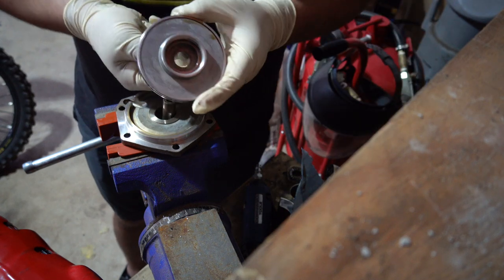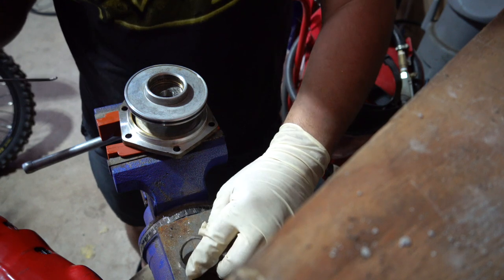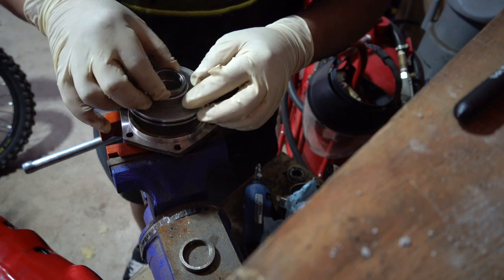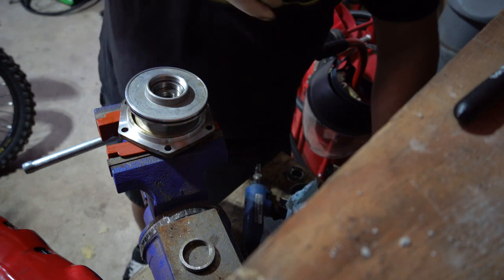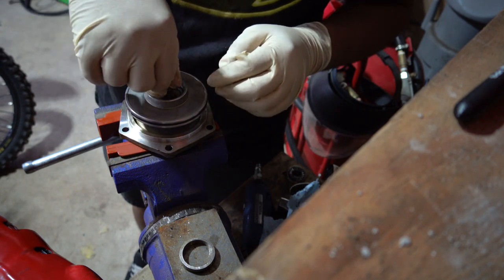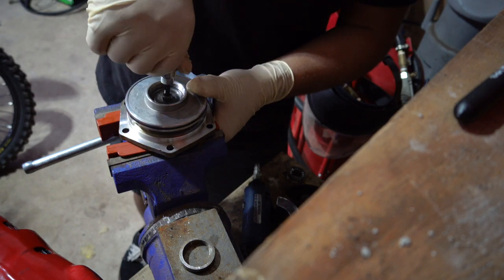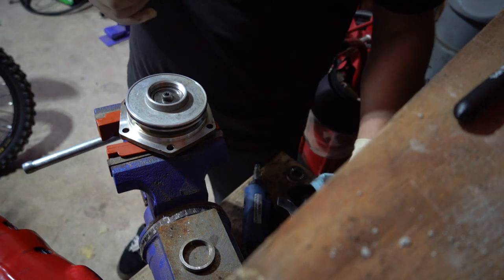We got this other bearing out and now we can take the sleeve off — I'm going to get a pick to get that out. We'll throw the new ring in, get this cleaned up, make sure there's no debris in there. Now throw the new ring in, make sure it seats all the way at the bottom. Then start throwing everything back in — the bearing, and then the bolt. Start tightening this down. Not often you come in contact with these reverse threads, so it feels very weird getting tight the wrong way. Make sure you press the piston all the way in so you don't have to keep threading it. Now it's tight so we're going to torque it to 8 newton meters.